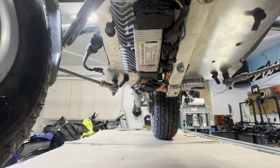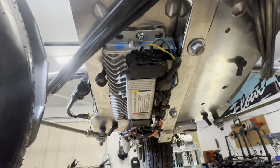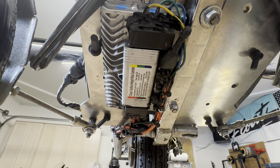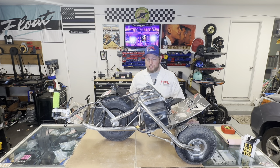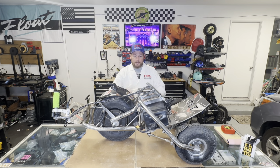The controller is just a standard e-bike controller rated at 72 volts, with an 84-volt battery. It seems to work fine for what it is. One thing I'm not a big fan of is a lot of the wires are exposed underneath. The benefit is if one gets pulled you're not going to nosedive, but the downside is they're exposed to the elements. I did notice a lot of waterproofing on the wires themselves. One of the nice things about this standard controller is there's no proprietary software lock — you can modify it however you want. You can swap the controller for a VESC module, or run a vampire battery via the XT90 connector.